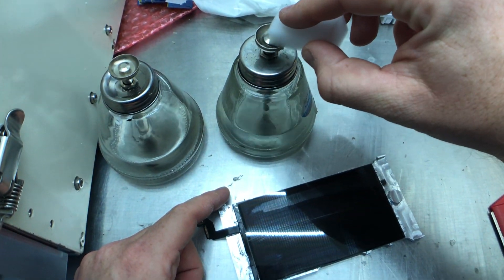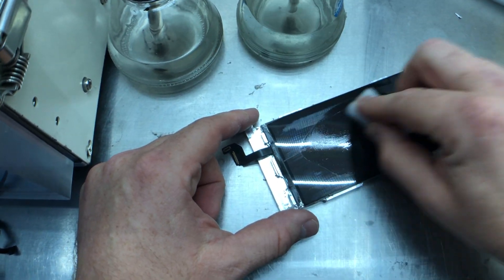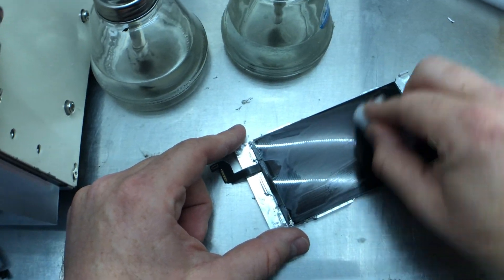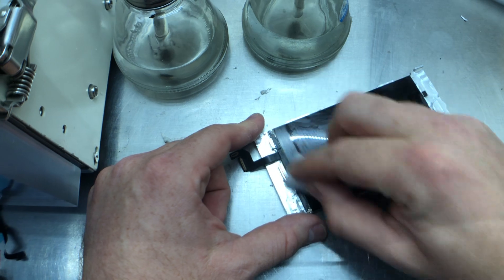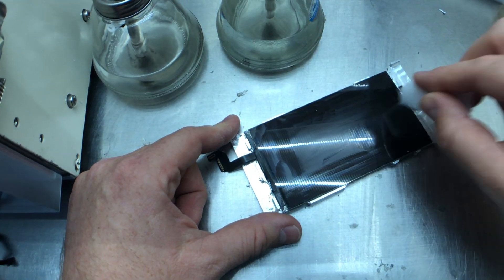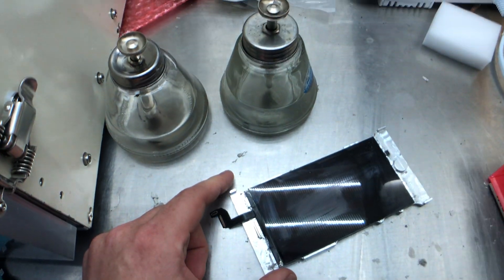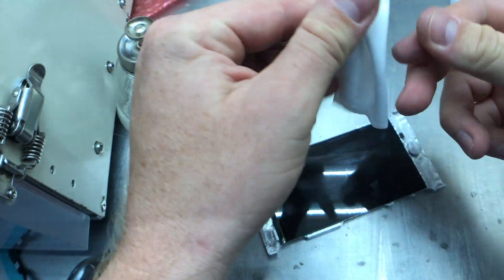Put a bit of acetone on some white sponge in the middle and wait for it to start drying before going to the edges. If you go to the edges while it's still quite wet, it goes into the backlight through the edges and creates either wet spots — which are really visible on all colors — or diagonal white lines. You can see I've got the worst of that glue off but there's still quite a lot of residue, so I'm just going to get the white cloth and clean it up.